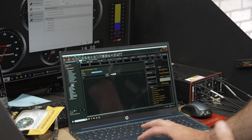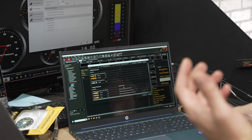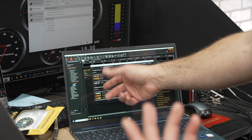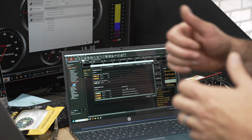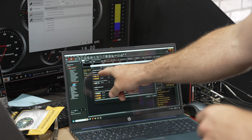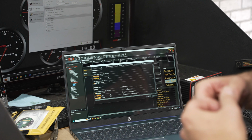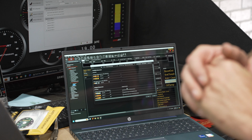wired up yet. So we'll go to wiring under rotary trim module number 1, we'll go to assign, and right then and there you can see what we have available to us. So we want to use an AVI, you could use an SPI, but in this particular instance we'll go with the AVI. And we have AVI 2, which I think is used by the ignition. For some reason, I don't know why it's not enabled here or being used. AVI 5, pin 20 on the smaller connector off the ECU itself.